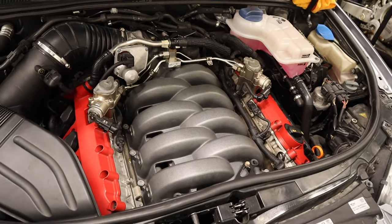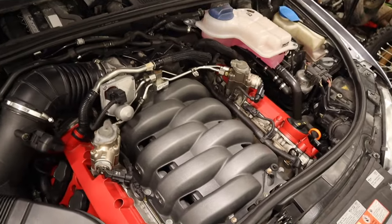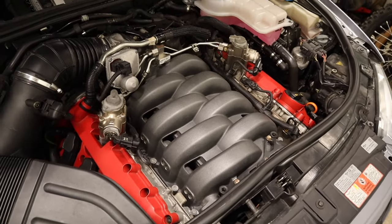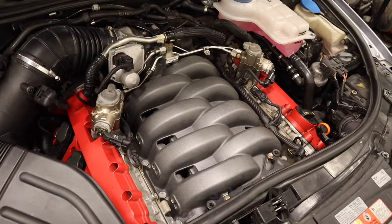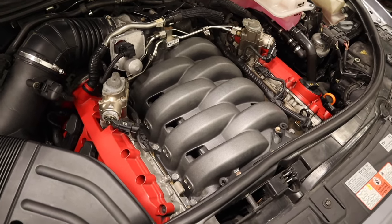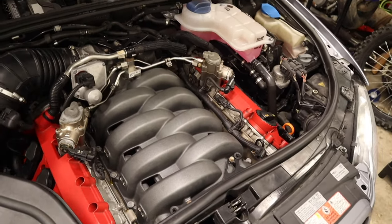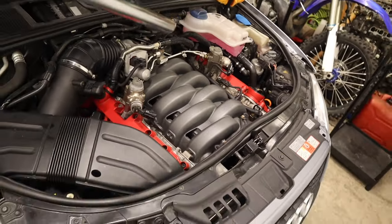What I was saying about the rear timing covers and cam girdle seals — if we do it in the car, it's going to be anaerobic sealant. But we're probably going to pull the motor on this car and do a bunch of other stuff, including rod bearings at some point. It would be really interesting if for the Sprint Blue car he does King coated rod bearings, because there's a handful of cases where people blow out rod bearings. I haven't done oil analysis for this car; I don't know if there's copper in the stock ones.